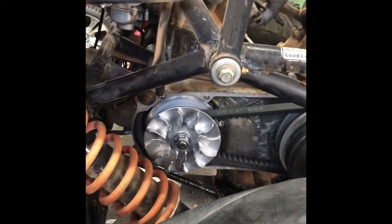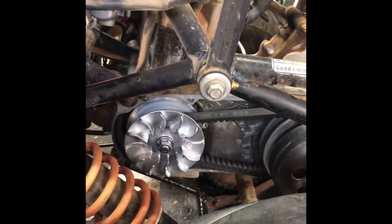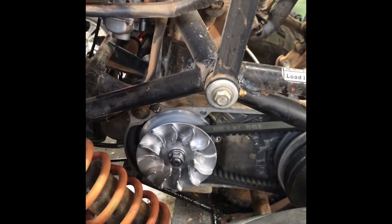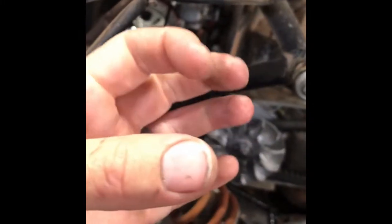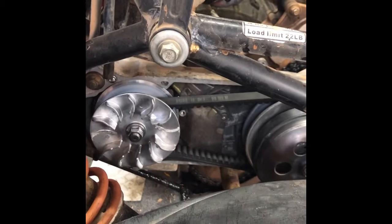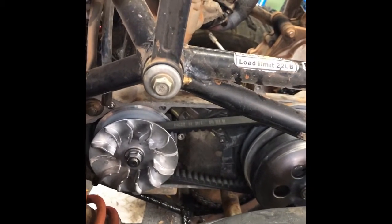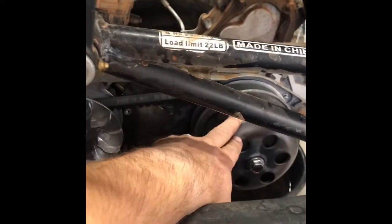So what I want to talk about today is: is there a way that you can toy with and change the gear ratio of the CVT — continuous variable transmission — that comes on these GY6 engines? The answer, I'm delighted to tell you, is yes, with surprisingly good results. It works much like a snowmobile where centrifugal weights inside expand out and grab the outer gear that drives your wheel. The question is: at what engine RPM is it actually engaging the axle of your wheels?